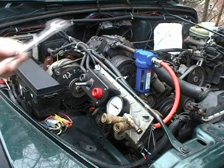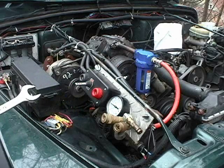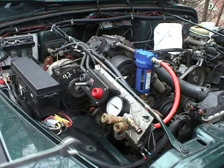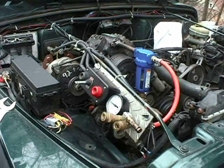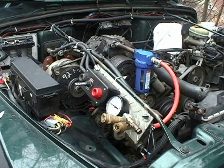The oil will need to be captured and returned to the compressor to allow it to have continued lubrication. A small modification of your air oil separator may be required if it's a newer model. From there, we go through an air line to our manifold. Here we have our most important component: the pop-off safety valve. This valve I am using is 150 PSI. Do not use a valve that goes higher because most air fittings and attachments are not rated past 150 PSI. The next most useful part is the air pressure switch, which turns off at 145 PSI and turns on at 110 PSI, allowing the system to cycle.